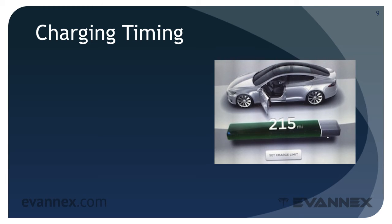Each 10% of battery capacity will take about an hour of charging. Although the length of charging time isn't particularly important when you charge at home overnight, it is important when you're on the road. The battery charge indicator has markings every 10%, so if you're at 60% of full charge, it will take about three hours to get to 90% of your full charge.